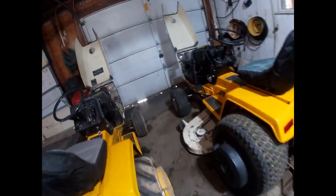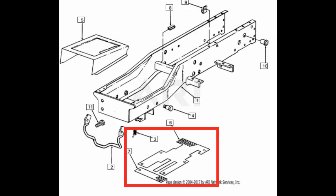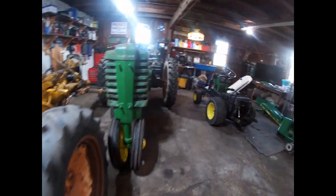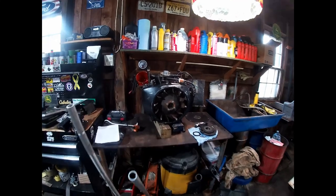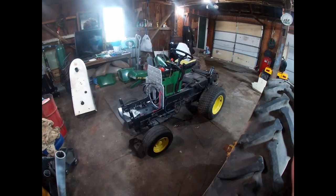On the 2072, they also have a crude example of a belly screen, but it is still there. On these Cub Cadets — the 82 series — a lot of times the belly screen is usually there but cracked or falling off. I highly recommend making sure that it is in place. If you have to make a new one out of mesh, do so. Anything you can do to prevent debris from getting into that flywheel helps.